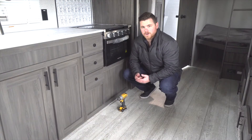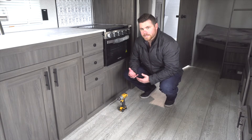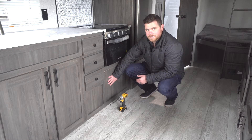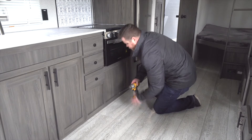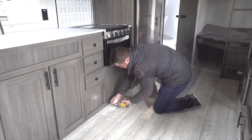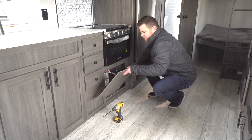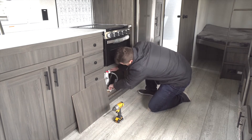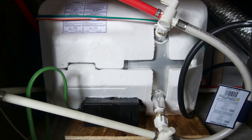Now we're inside the trailer. Wait about 20 to 30 minutes for that freshwater system to drain as much as possible. This access panel is going to let you get to the water heater bypass — it's just four screws holding that on. Once you have it unscrewed, pull this panel off. To bypass the water heater, you've got two knobs. Do a quarter turn so that it's going with the line — that's how you know the water heater is bypassed.